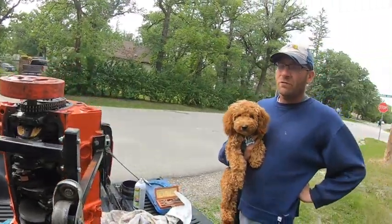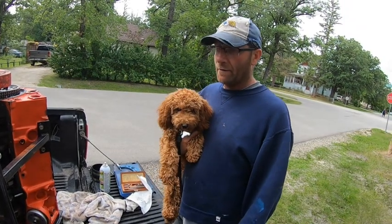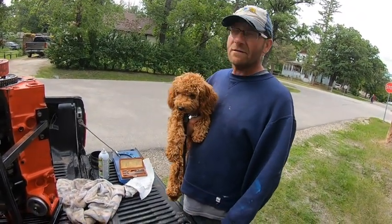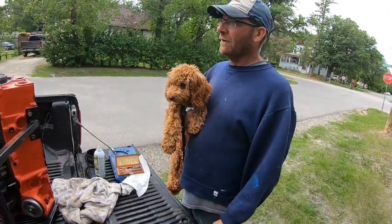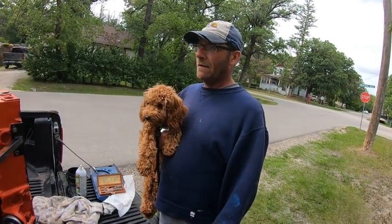Oh well, I guess let's put the pan on. Like I said, everything's gonna come apart when it comes time to put it together. And we'll clean up everything and mic the rest of the block. This was just kind of a quickie, just to see what we're looking at here. And like I said, we'll pull the cam out in a minute since there's no lifters. Well, the lifters are garbage.